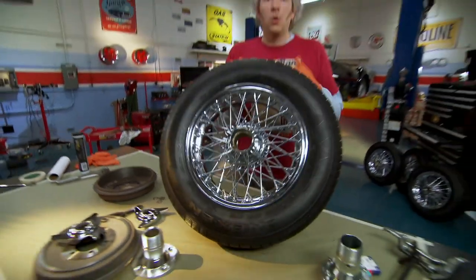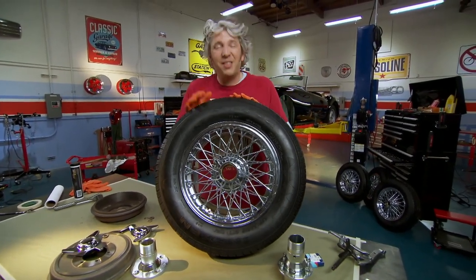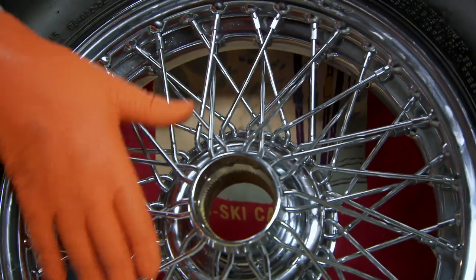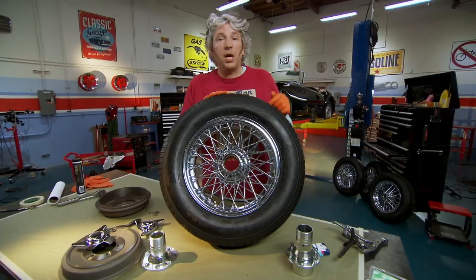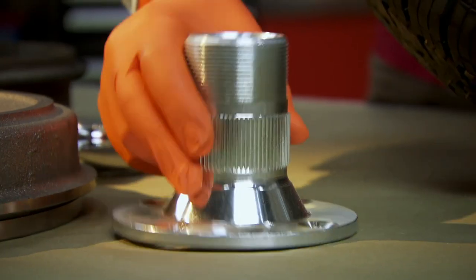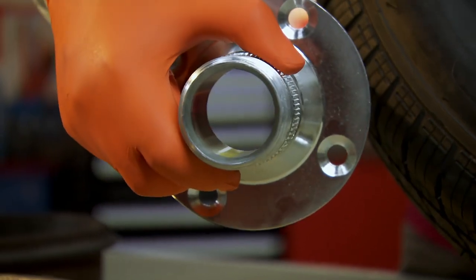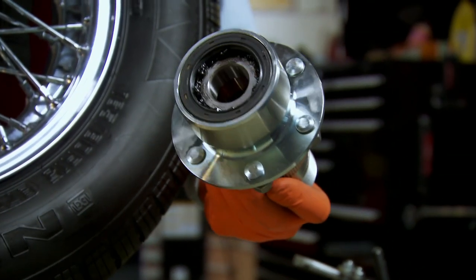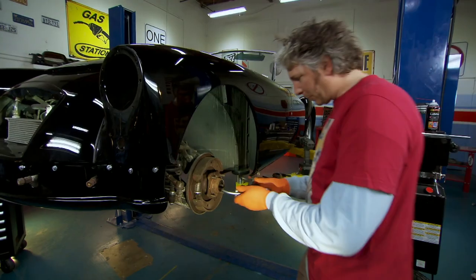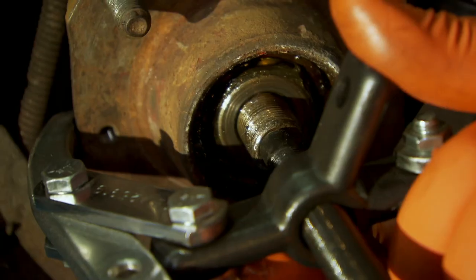Here are our brand new wheels. You can see they're just perfect for an old English classic — lovely chrome spokes. There are no holes for the studs because they're held on with spinners, and the spinners sit on these specially modified hubs. The rear hubs are quite simple — they just bolt into place — but the front hub actually has to go in place of what's already there, so I need to remove that first. This is a relatively straightforward conversion that a home mechanic could attempt. You pull out the pin, undo the castellated nut, and the rest of the hub can be removed. You'll need a puller to remove the hub.